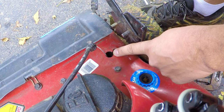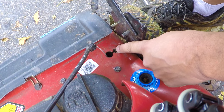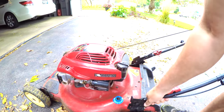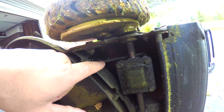On my other video I have a clutched mower and there was another cable in here — I had to slide the second cable through this one and then slide this out. Then what you want to do is tip over your motor so the carburetor is facing upwards. This is where it connects right here.